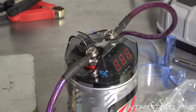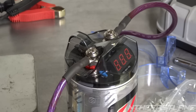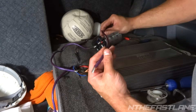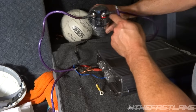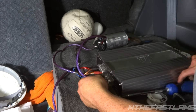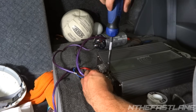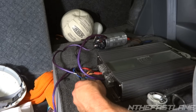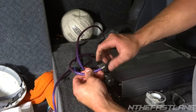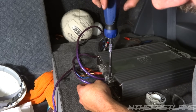Here's the final product. Just got to make sure your wires are far enough back so the bolt can flatten out to the connector, and that's pretty much it. The two wires on the capacitor: we're going to put the positive — which has a little red marker and a plus sign — into the positive terminal on the amplifier and screw that down. Keep note the battery is not hooked up just yet. Then we take the negative and put it in the negative terminal.